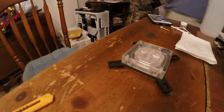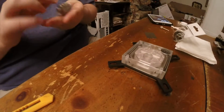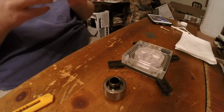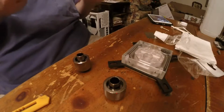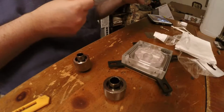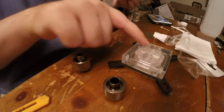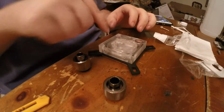Go ahead and attach the fittings here to this thing. One thing you want to be aware of, it says on here, it doesn't matter for this, but I just want to mention now, that the inlet port has to be the G1 port nearest. So this is your input port, this is your output: your inflow, outflow, inlet, outlet. You have to be aware of that. That's a requirement of putting this thing in. I guess because the flow goes down here, turbulates through there and comes out there.